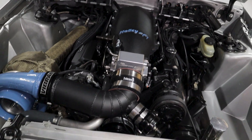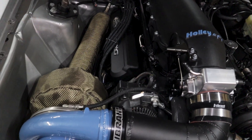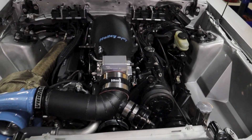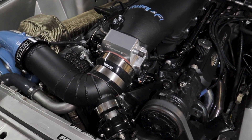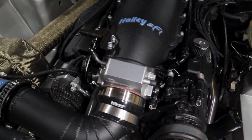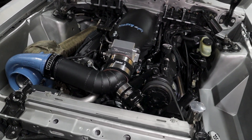I think we figured it out, so I'm going to tell you what was going on. Basically the car was idling high, my headers were glowing, and the car would backfire when you shut it off — we just couldn't figure it out. But today we removed the IAC because we thought it was stuck open, and it was. We made this plug for it right here and that seemed to take care of our issues. I'm going to let you hear it start up now.